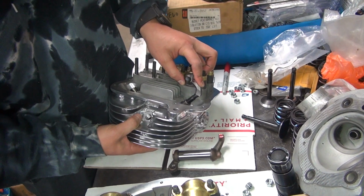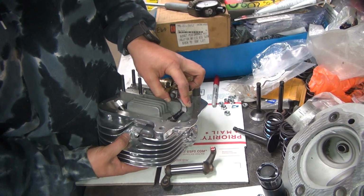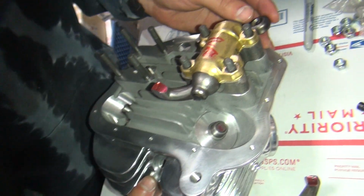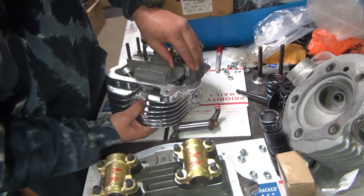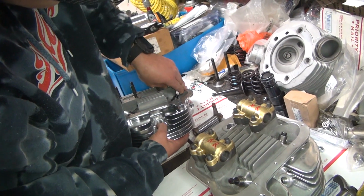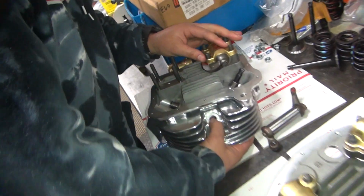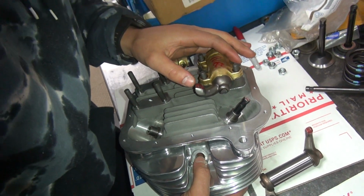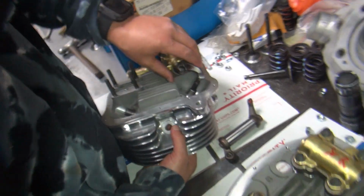Only the tip matters. Is there a mark on it now? See. Is there a rub mark? Nope. Push harder and keep going. We've got to find out if it's at the right angle. I don't want to grind the whole thing way off because I only got so much metal I want to take off. Looks like it's hitting that and then rocking over to the... The tip doesn't help us. You have to get on the flat spot. Yeah.